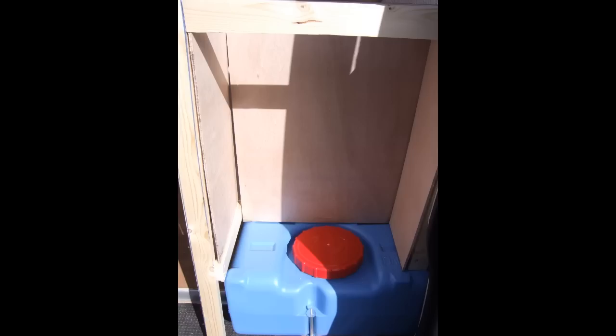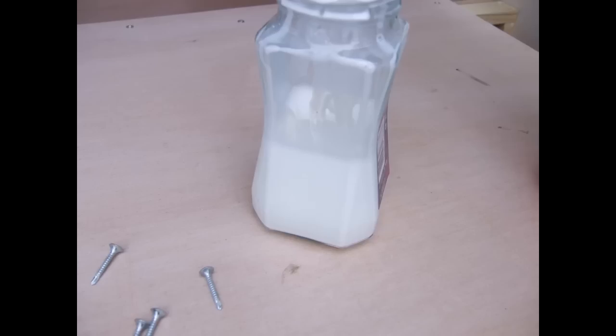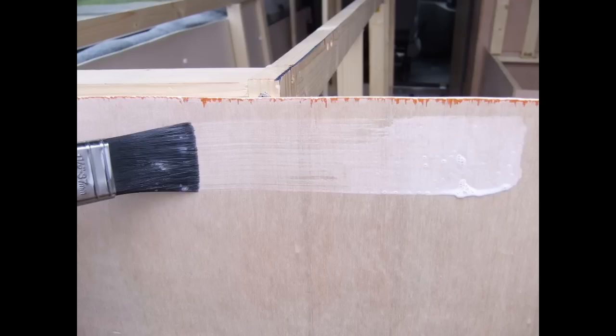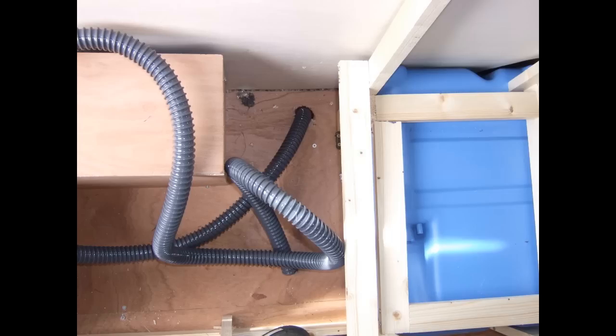Here's the area where I can fill up with fresh water — there'll be a door on the outside as well. To help the sticky vinyl — Fablon — adhere to the wood, I treated the wood with a mixture of PVA glue and water, just painted on. I read this tip when researching vinyl and it makes the surface much tackier so the vinyl sticks with no problems. The waste pipe goes through the van floor to an underbody waste tank — a Cak Tanks unit specifically molded to fit the shape of this van's underbody.